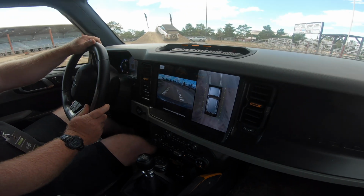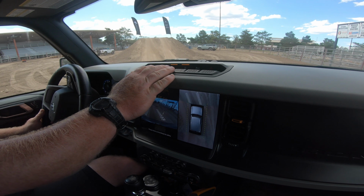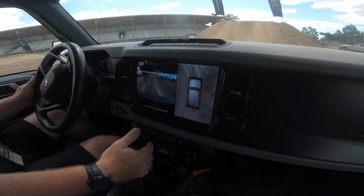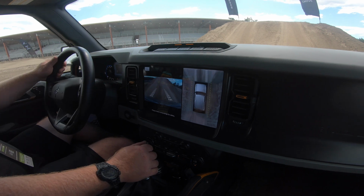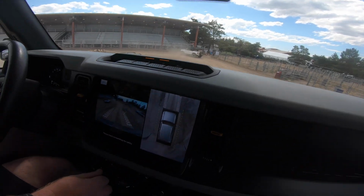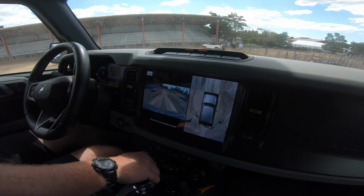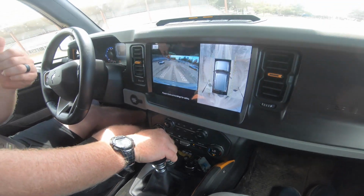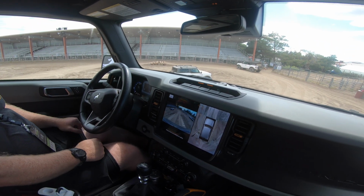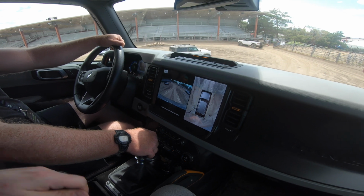I physically went in and took mine out because I updated all the suspension underneath the truck. I would actually be curious to know if you know of any aftermarket solutions on that, because we've been looking for a sway bar disconnect, like a manual type. But Anti-Rock does stuff for Jeep. So as we come to the top here, I don't know how that would be applicable to the Raptor. They might have some, just like they would on a Jeep, where you have the upper attached to your axle, and then they pull out a link. You could do a linkage system maybe with this. Yeah, that's kind of what we were thinking, like for street versus off road, physically pull it off.